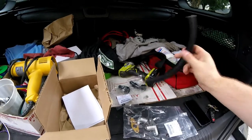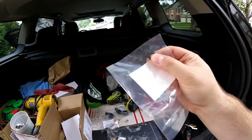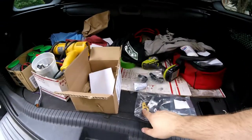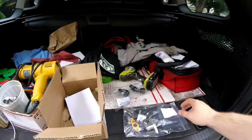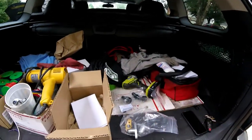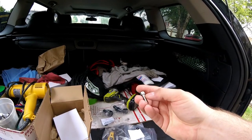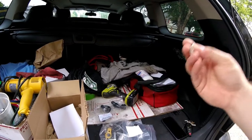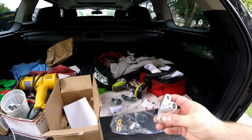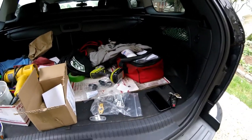I'm just gonna go ahead and do these push-on fittings - there's new fresh hose. I also got these little rubber grommets, seals for the bolts that go through the fitting on the pan. I also have a new pan, new bolts, everything. I think I'm also going to put a little bit of sealant either on the back or the front of it just to help, because it leaks everywhere - it leaks from the line, it leaks from the fitting. So I got new fittings and everything.